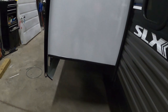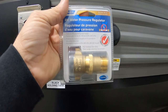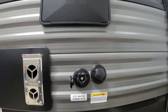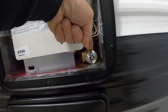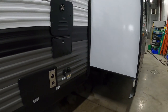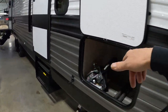There are two ways to put water in here. At campsites we're going to use the city water connection. First and foremost, always use a water pressure regulator — it's in your convenience pack and reduces water pressure to 40 to 50 PSI, protecting the lines in your unit, since you don't know what the water pressure is at different campsites. Hook that up, hook up your hose, and go ahead and turn it on. Make sure your pressure release valve is closed before turning it on. Then we're going to go inside, open up your slide, and turn on all your water taps — sinks, showers — to get a nice steady flow of water going through them. Then shut them off and you're all set to camp.